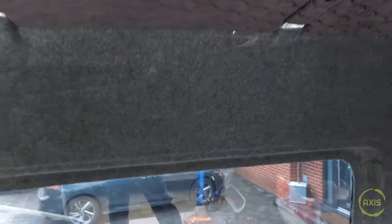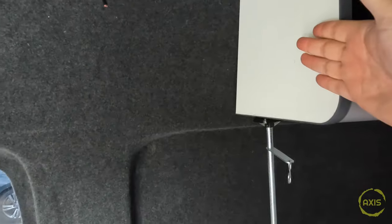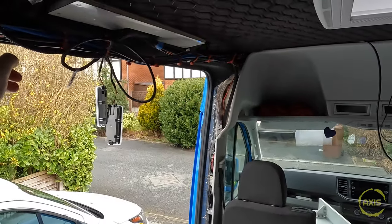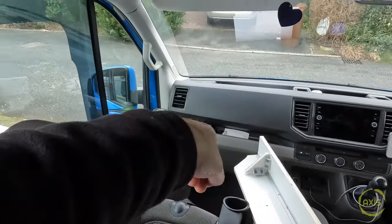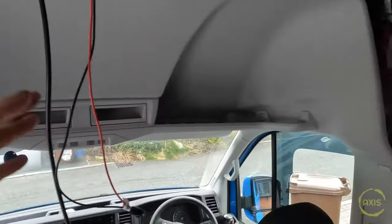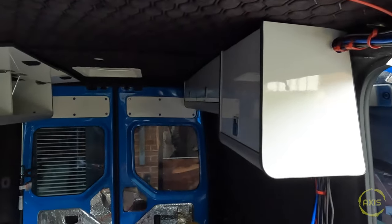That's the two main units. I've got the other top locker for this side, but I can't put that one in yet because these are flush up to the back and they can't go back any further. So what I'll do is build the shower section from here, going back that way, and then I'll see where that locker lines up. I've also got the front one to go in as well. Hence why I've not put the cable tray on yet - because I might need to trim it. The diameter should fit, but I'd rather get this mounted in first and then come back. I know the shower's going there, and this side goes back to the pillar at the back anyway.